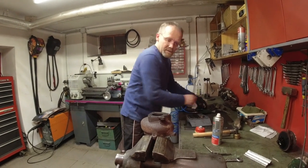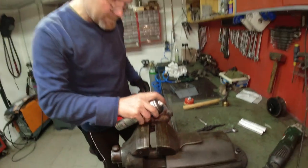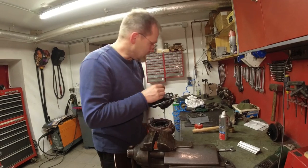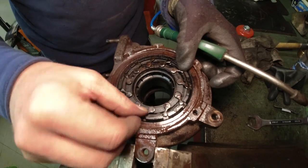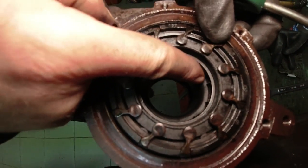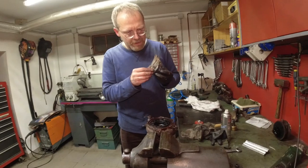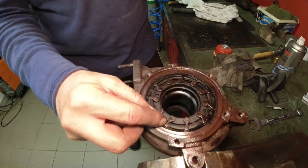You can take it off like a water pump. Now we got to do these two. When you do them now and they're clean and you have later on a turbocharger failure, you actually have a chance to get that turbocharger out without body off. This is the boost adjustment from the turbocharger — see these little fins down here? They basically can open or reduce the airflow. Depending on the boost required, this turbocharger will regulate down or up. There's an electric actuator here, and this actuator goes on a little lever that moves this boost adjustment.